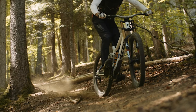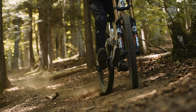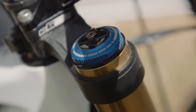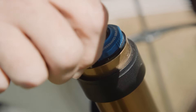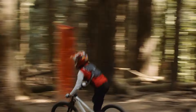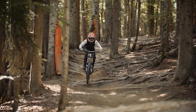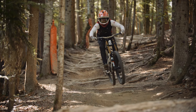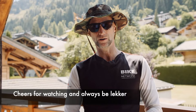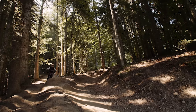For troubleshooting: if you're uncomfortable on the steeps you can try raising the front end of the bike a little and slowing down the rebound on your shock. On high speed lines, adding compression will generally help you. On slower technical lines, reducing compression will help the bike settle. It's very important to keep the front and rear as balanced as possible. Remember your body is also suspension so you want to be as active as possible on the bike — use your legs to hold yourself up and your upper body to absorb the hits and stay on line. Lastly, you're probably not paid to do this so only take calculated risks. Nobody knows or cares how fast you were in the bike park — keep it chilled, fun, and have a good time out there.